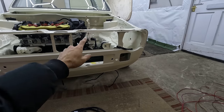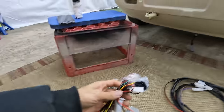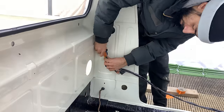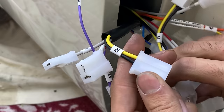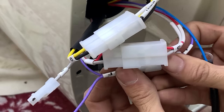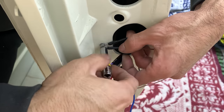These looms are a one-to-one copy of what is originally fitted into the Caddy, and to make it even better, each wire is labelled just in case you need it in the future. I also got some rare bulb holders made up — these are virtually impossible to find. I got a couple of these looms made, so if any of you guys want one, you can contact me on Instagram or send me an email which I'll put in the description below. To save the headache of fishing the wires through, I taped the old loom and the new loom together and pulled them through the inner panel. Once that was completed, I fed the second part of the loom, which handles the driver's side lights, through the holes in the frame. Moving to the passenger side rear, I carefully connected the plugs using the labels on the wire to ensure the correct location.